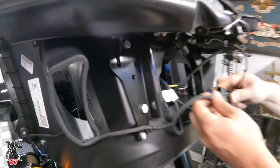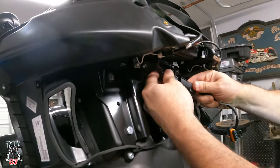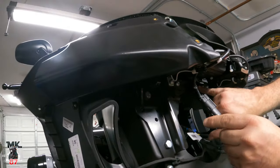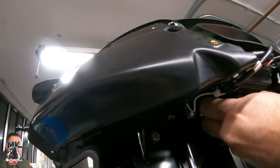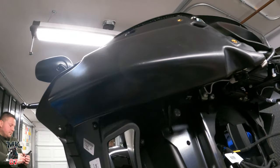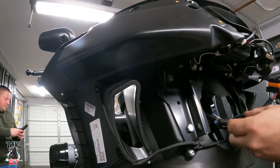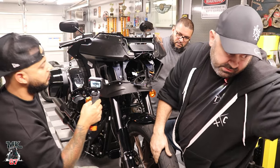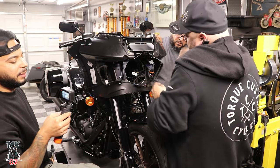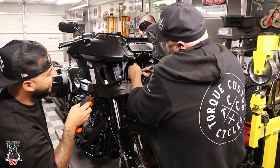This will now run through your headlight to power the amplifier, and then through the hole up here on the frame. It slides right in nice. So now this becomes your new headlight plug. I mean, Harley makes it kind of pretty easy — they even give you zip ties in the package. Did we just say Harley makes something easy?